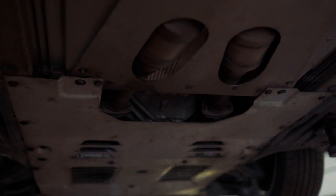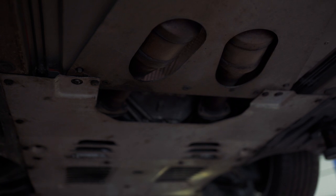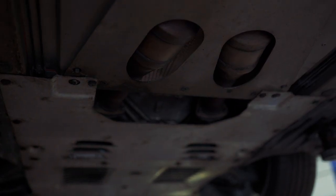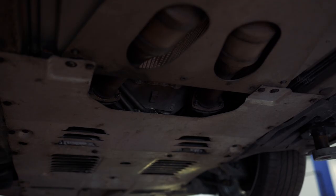We're underneath now — this is a cold start, still on fast idle. As you can hear, directly underneath the sump there are absolutely no abnormal noises whatsoever. The engine sounds silky smooth. Now we're warm and increasing the RPM to see if we can promote the condition — at this speed there are still no abnormal noises, so the condition isn't even detectable yet.